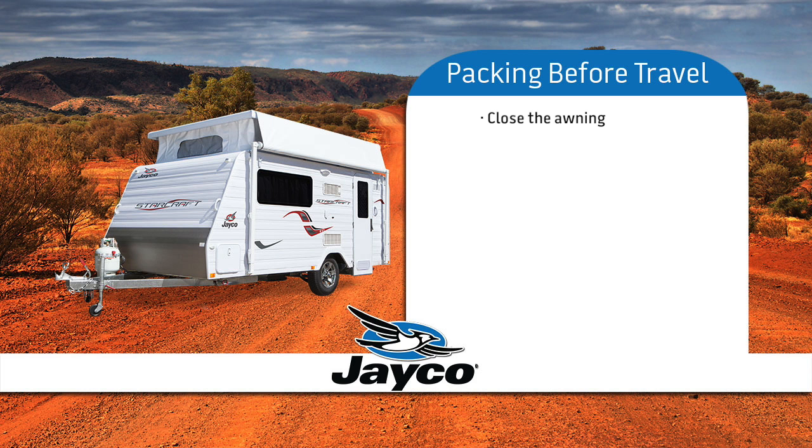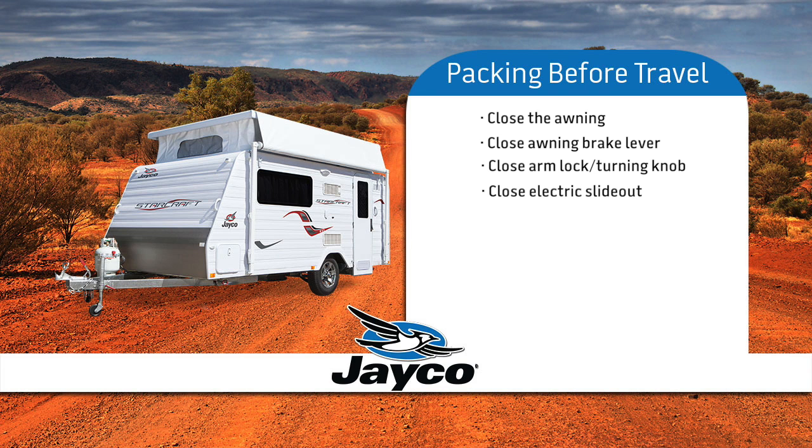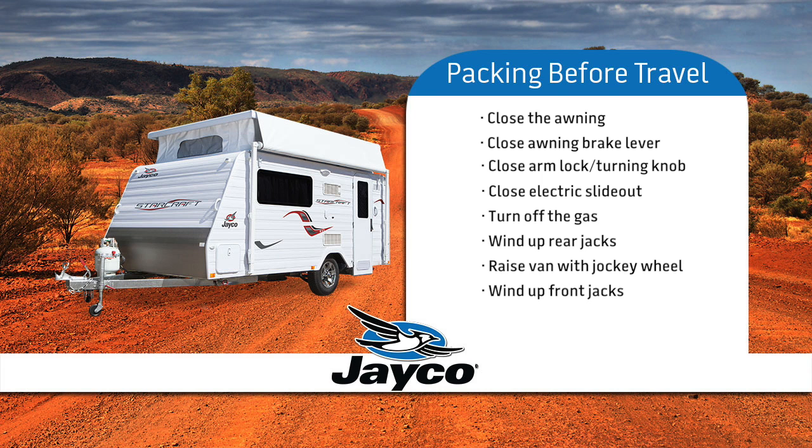Close the awning. Check that the brake lever of the awning is in the closed position as well as the arm storage lock and turning knob is tight. Close the electric slide out. Turn off the gas. Wind the rear jacks up. Put the jockey wheel into the bracket and raise the jockey wheel until it is lifting the front of the van. Wind up the front jacks. Lower the jockey wheel so the hitch on your van can catch onto the tow ball. Release the handbrake.